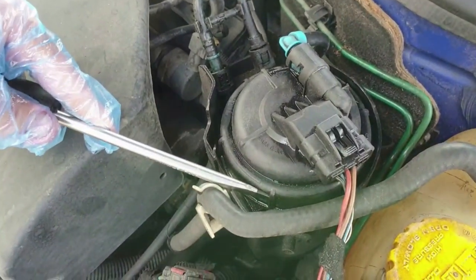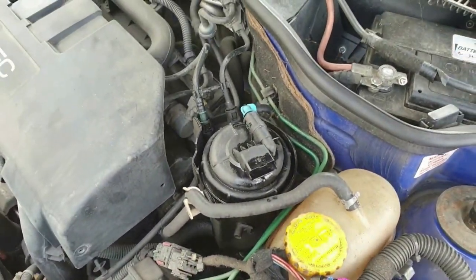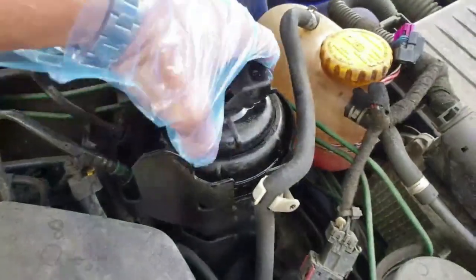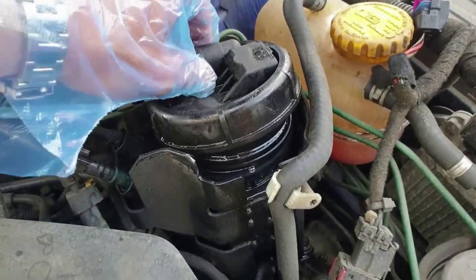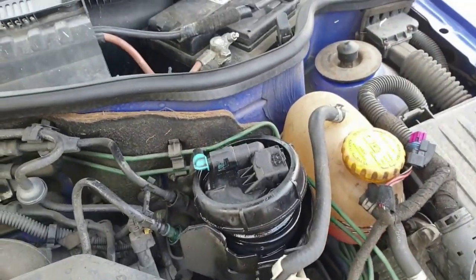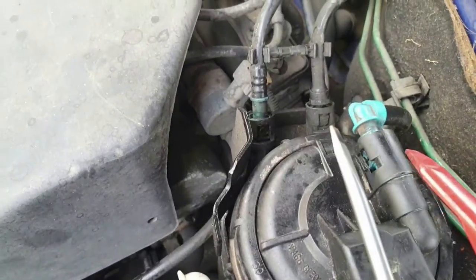This collar may have a special removal tool, or perhaps big pliers-type oil filter wrench would work, but I'm going to lightly tap a flatted screwdriver into these tabs and do it anti-clockwise — but first we'll have to remove this wiring connector. So I've lightly tapped this collar with a hammer about half a turn and now it's loose. Remember this housing will be full of diesel so expect a little spillage. I'm going to get my fluid extractor set up and suck about half the volume of diesel out. I'll aim to get the pipe as far down as possible as these canisters are designed to separate any water that might have contaminated the fuel, and the water will of course settle at the bottom. This extractor was a gift — I think it was from Lidl. You just hook it up to your battery, clip the exit pipe onto a container, and vacuum any fluids out of reservoirs or even the oil by going down the dipstick tube.